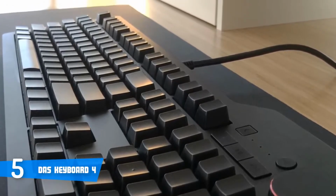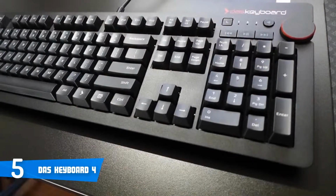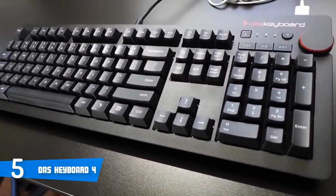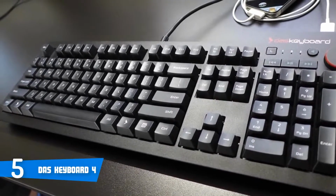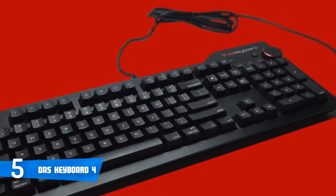It's worth mentioning that this keyboard has the N-key rollover feature, which means that each key is scanned completely independently by the keyboard hardware so that each key press is correctly detected regardless of how many other keys are being pressed or held down at the time. This is pretty useful for writers and gamers.